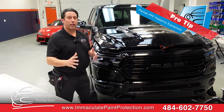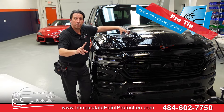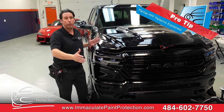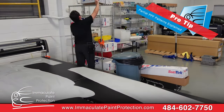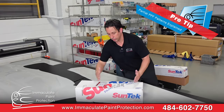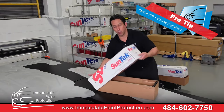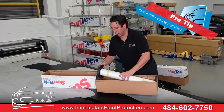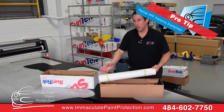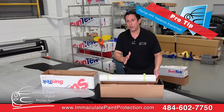When you're looking at paint protection film installers and getting a partial hood done, there are typically two different pattern options available: an 18-inch pattern and a 24-inch pattern. This is a 24-inch wide roll of material, which means if you select a 24-inch pattern, it can cut off of this roll. There's also an 18-inch roll, which is six inches narrower, meaning the pattern is not going to cover as much.